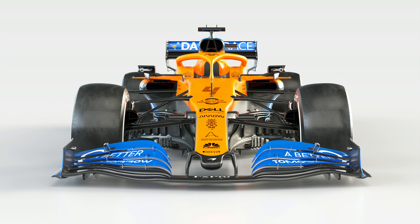For me personally, the most interesting feature has to be the airbox. The bulb-shaped design is split into four main sections, with more baffles hidden away inside to divert airflow to the various sources that require it. Interestingly, the top of the airbox also leans forward quite dramatically, casting a shadow over the top of the driver, and undoubtedly aiding in not only capturing flow off the halo and the driver's helmet, but also ramming it down the throat of the various inlets.